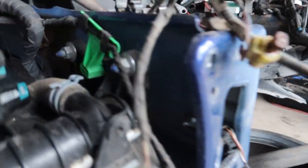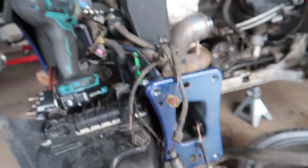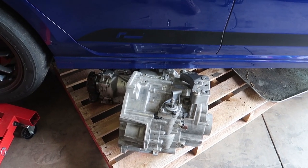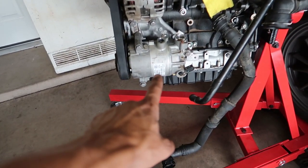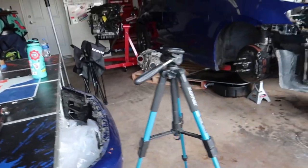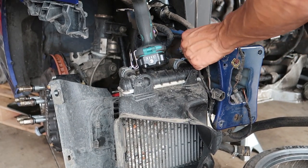What's up guys, back for another episode. Today we are going to get rid of this auxiliary radiator — it's literally just those two bolts and I'll probably have to move this wiring. We might start cleaning in here a little bit. I want to get this mount off; the trans is going to be sent to Paul over at Shop DAP — he's going to do a teardown on it. I gotta ask him, I should probably take off my transfer case. I need to get ratchet straps to strap that down. We're gonna get the AC pump off — I got somebody buying that — and then the condenser off this whole assembly.